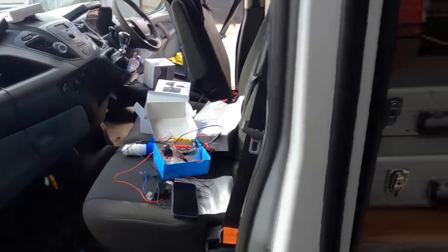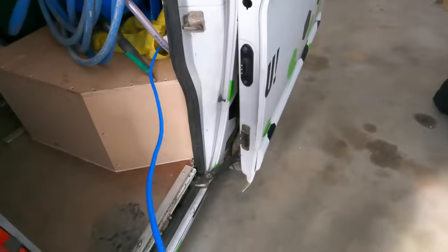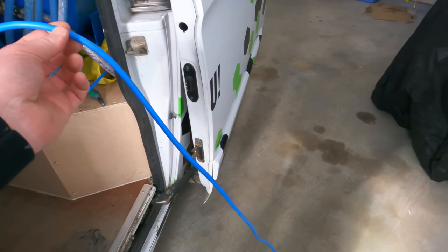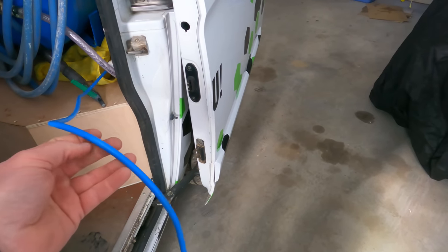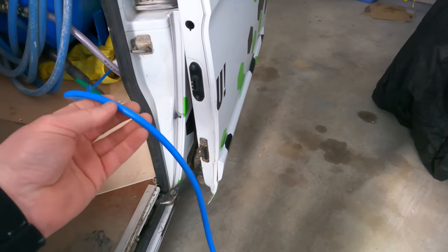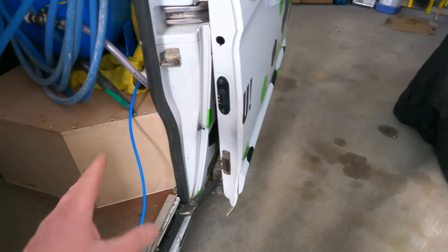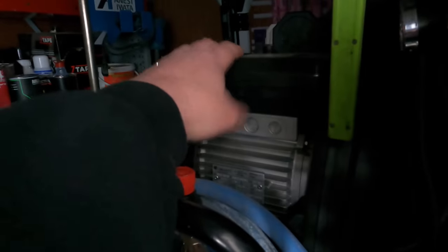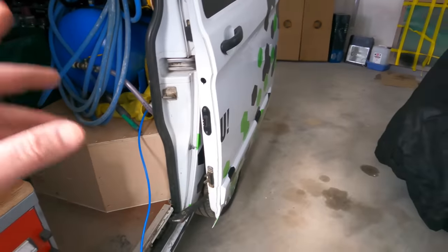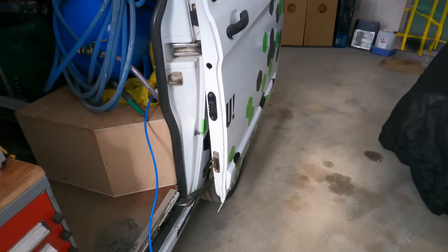So that's happening. I spoke to my compressor guy. Now my mains hook up. It's 16 amp, but apparently it's too thin. Really, what you want is a 2.5 mil flex. Because if you run a 1.5 mil flex, even though it's 16 amp, it puts strain on something to do with the motor and the gizmos up the top here. So I have gone and got loads more wire in a 2.5 mil, nice thick chunky cable.